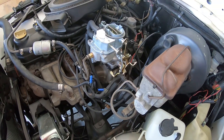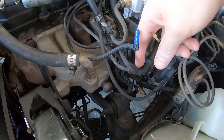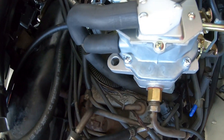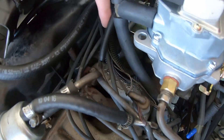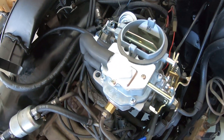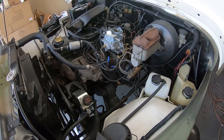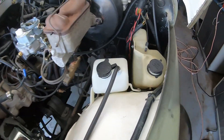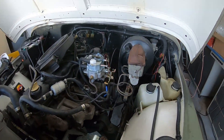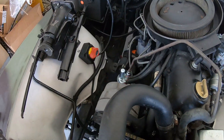We got everything hooked back up, cranked it up, and it purrs like a kitten. We got the throttle linkage and springs, capped off all the empty vacuum lines — we'll eventually eliminate a lot of these once we figure out what they do. Plugged the fuel line back in and teed into the ported vacuum for the vacuum advance on the distributor — there was already a tee there and we added another one going to the distributor's vacuum advance. Hooked up all the wiring connectors that still existed. The Nutter bypass cable is neatly tied up with a little bit of extra cable. The owner is considering ordering another ignition control module because of that missing potting we noted earlier, but the existing one is bolted up down there. That's about it.